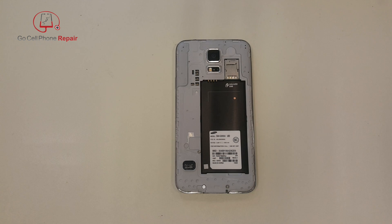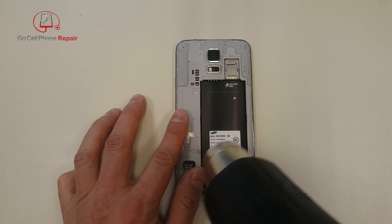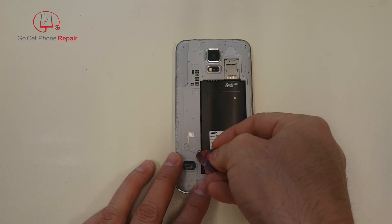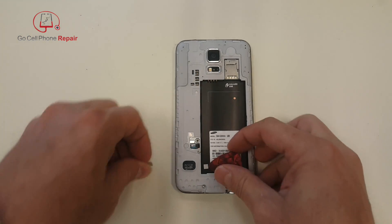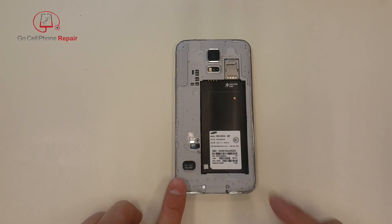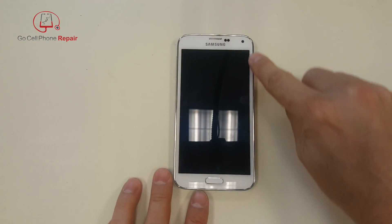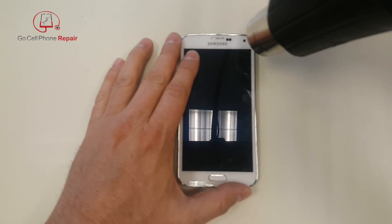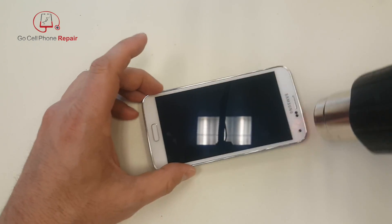You can use your fingernail or whatever, but if you hit this with some heat there's a small amount of adhesive under this little panel. So I'll warm that up, come under here, and we should be able to lift this — just like that. I'm not going to disconnect this yet until I'm actually pulling the screen off, because if I disconnect it and it's flopping around it's easy to snag it as you're working. This is going to require basically just heating around the edges until we can get the playing card on the inside.